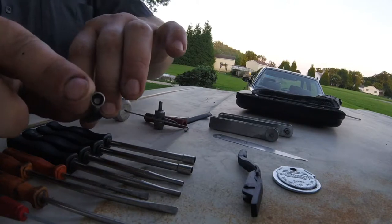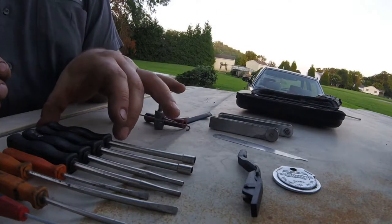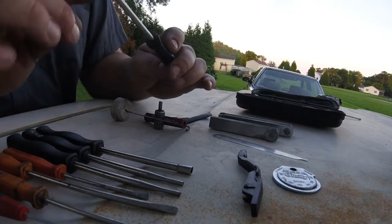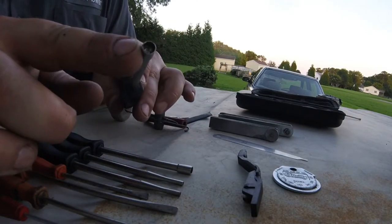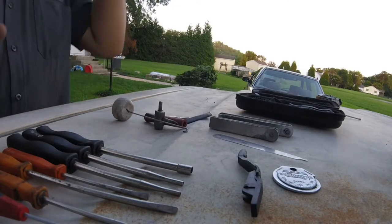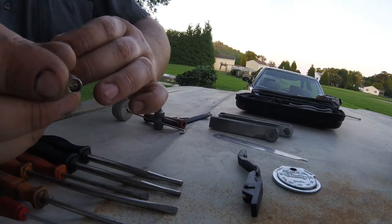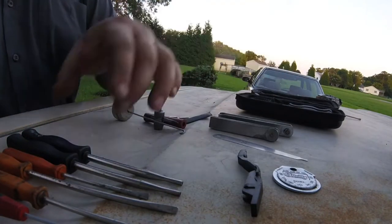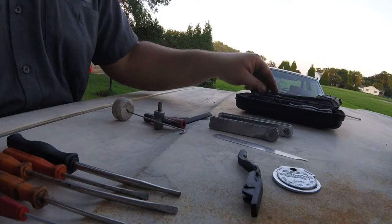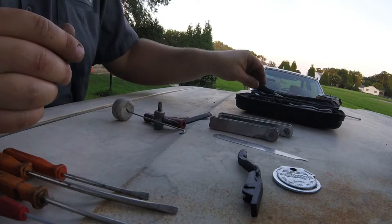This is what's known as the Pac-Man. It has one little indentation sticking on the inside. I can't remember who uses those, but I've used that one before. They call this one the single D — it has one flat on the side of it. The carburetor on the Ole Henry project actually uses a single D adjusting screw. This one's the double D adjusting screw, which is two flats. There is also the small Pac-Man, which some of the barrel style throttle Walbro carburetors use, and then there's a really tiny single D that those tiny Walbros use as well.